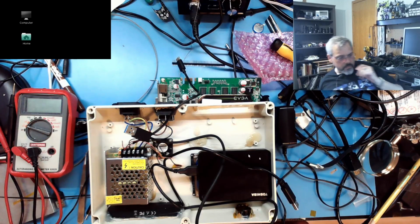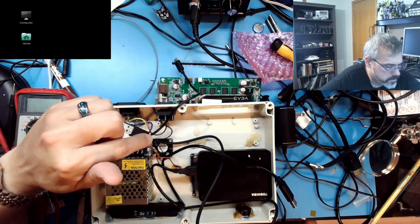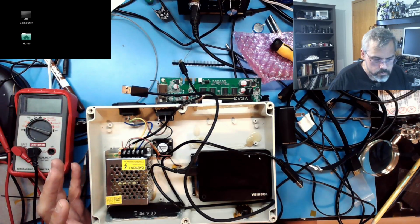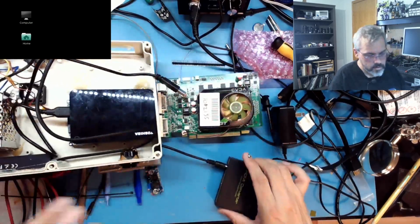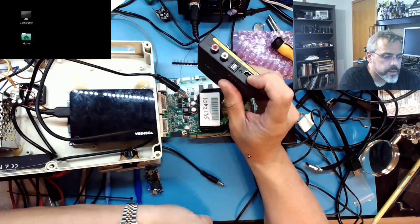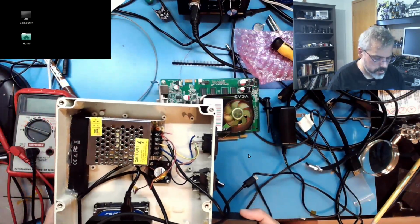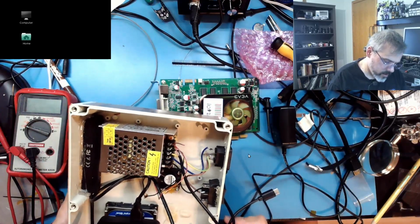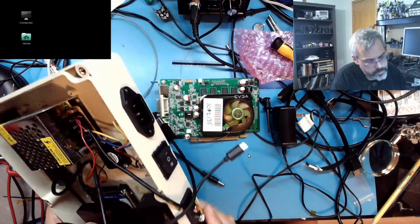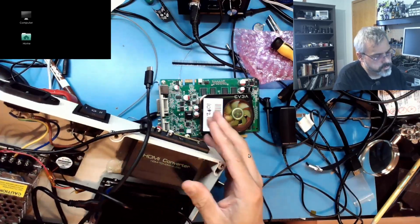So the issue I'm running into is I have a fan on here, but it screams like it's dying. And it doesn't move enough air because there's just not enough flow here. And I was using this externally. This converts HDMI pass through HDMI out, gives you optical and analog out, because the monitor I have this plugged into was never designed for HDMI. So the goal is this was originally mounted on here, so I'm going to remount it back in here. It's probably as simple as that.